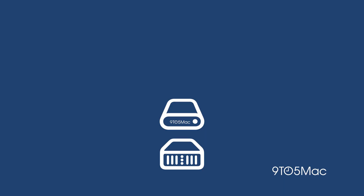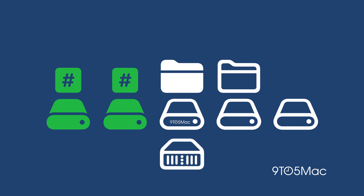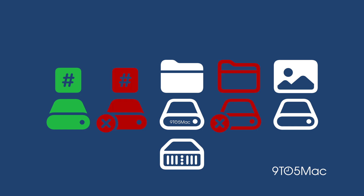Unraid is the complete opposite. You can have 0, 1, or 2 parity drives. Those should be the same size and the highest capacity drives possible, as you can use any drives smaller than them for the data. Those parity drives hold all your backup information, and then you can just add as many data drives as you want. Rather than striping the data — putting small pieces of each file onto every drive — the file, and even whole folders depending on how you set it up, will be stored on just one of your data drives, with the parity drives holding the parity data and offering redundancy for the whole array. This means you can lose as many drives as you have parity drives and still have all your data.